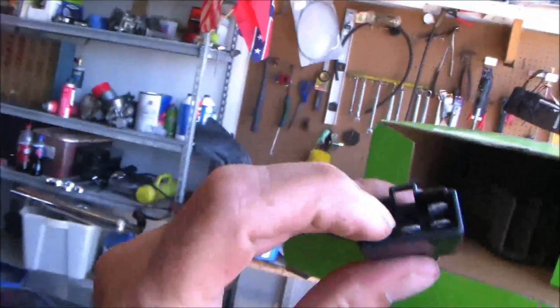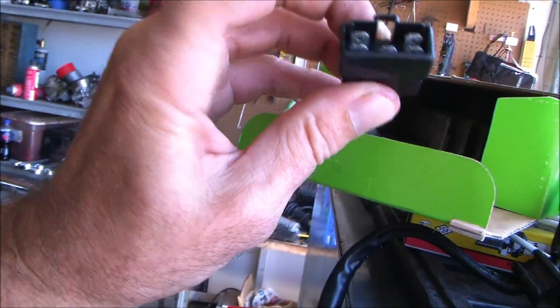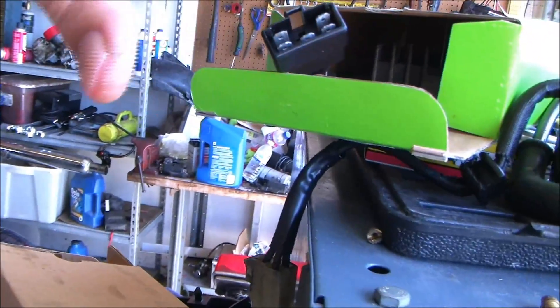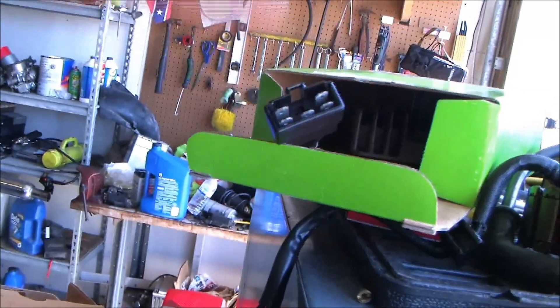These newer bikes are pretty much the same. There's a rectifier here — yes there is. Nine times out of ten on newer bikes, two wires by themselves are gonna be your hot and your ground, and then your other three are gonna be your AC leads on your connector. If it's the eight-wire connector and they're not using two in between, those three are probably in the middle or down towards one end.